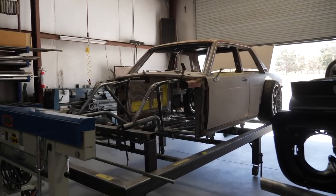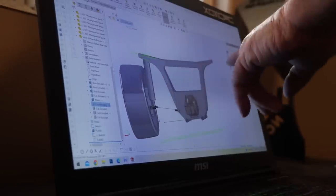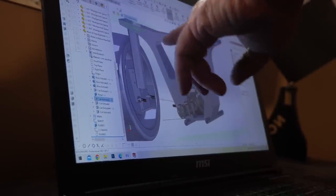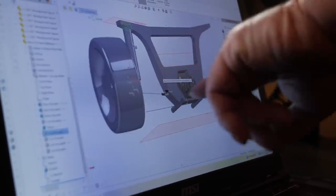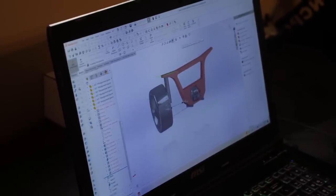On the 69 all-wheel-drive Datsun 510, we haven't made a lot of progress — too busy with the other builds. We did some computer drawing and spent a little time chiseling out the main bulkhead structure for the rear. You can see the rear differential, wheel and tire, and strut assembly. We're cutting windows in the bulkhead to shave weight — this will all be 90,000 psi chromoly plate welded together, so it'll be a pretty light part. You can see the lower suspension pivot, the chassis tube, and the rear differential. The suspension arm appears to be angling up right now because we're building the car at full bump — completely bottomed out — so at actual ride height that arm will be completely level.